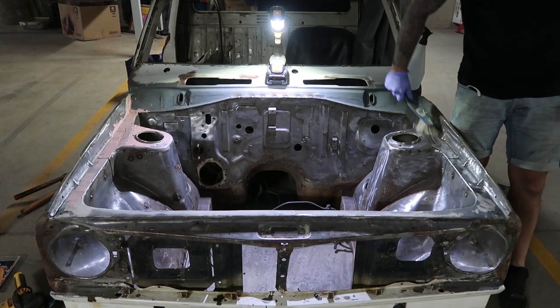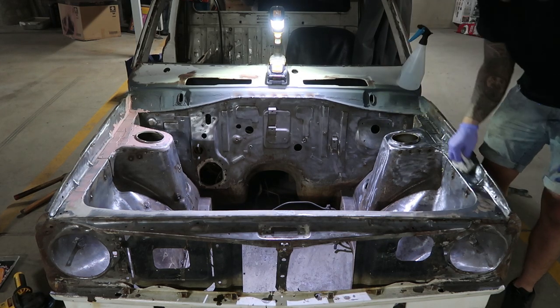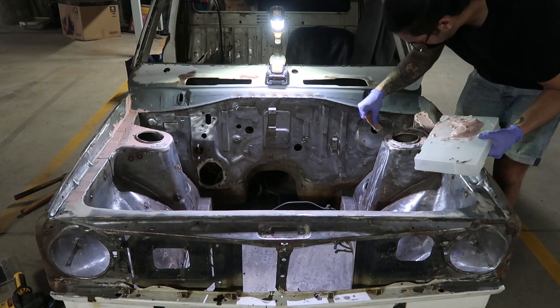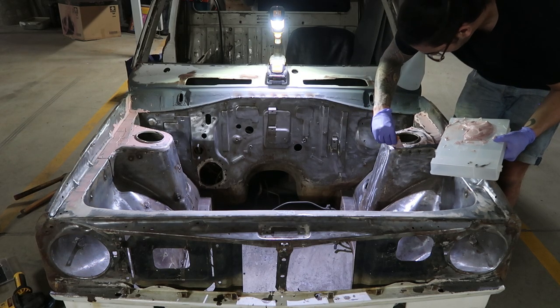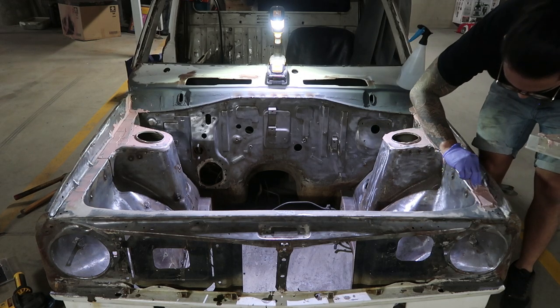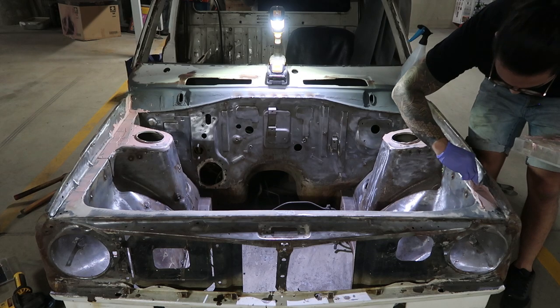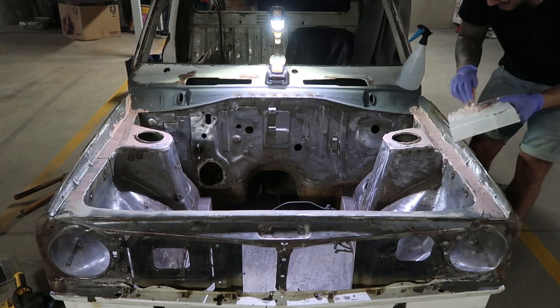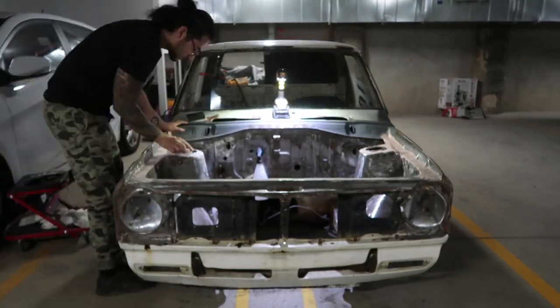But I'll just see how things hold up, only using automotive body filler. Some say it'll be fine, but I'll let you know how things go down the track. The key is to sand down the filler as much as possible, so it's like a layer of paint, which doesn't tend to crack from general vibrations and stress. Bits will probably pop off though if I get into a prang, but in that case, that'll probably be the least of my worries.